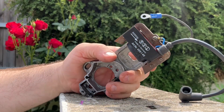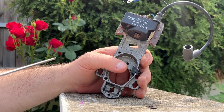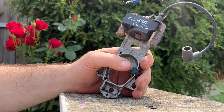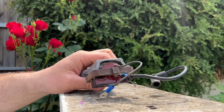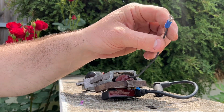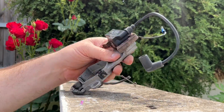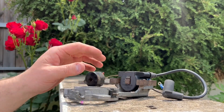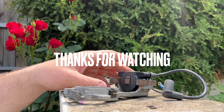Now you've upgraded your vintage ignition system. You can use the smaller original flywheel, this stator plate, and the new PVL coil. That's your kill switch lead, or toggle switch if you have an on-off switch. That's how you swap it over — you ditch the points and condenser, and you don't have to run the electronic ignition chip externally somewhere.